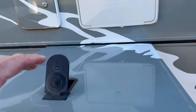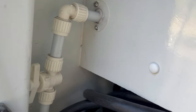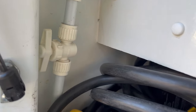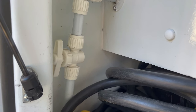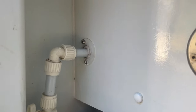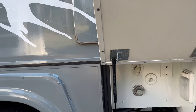In our first step, drain the water tank. In this case, it's a 64-gallon interior tank. This is the electric slash water cab. Right there is the valve, and it's in the open position. Most of the valves work that way. If they're in line with the actual tube, it's open. When you go across the tube, 90 degrees to it, that closes the valve. So this drains that, comes out of the bottom right here, and we've already done that. Good shape there.